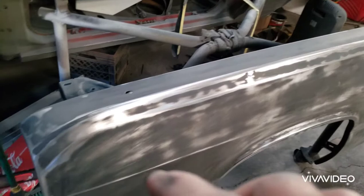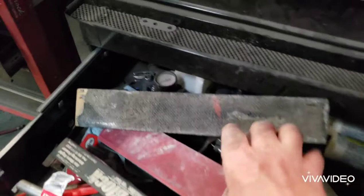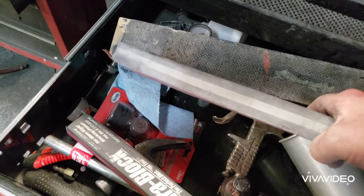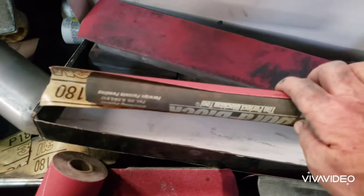The jams were done on that other fender and this one about a week ago, a little more. I've been blocking with 180 grit on various different blocks. I've used the 3M longboard that I've had since 1993 or '94. I've also got a flexible block — I don't know the brand, got it ages ago — but you can curve it and form it to the shape. We've got an egg-shaped curve for a fender. I didn't use that on this fender though; so far I've used the square block and a little round one.